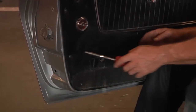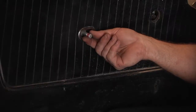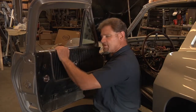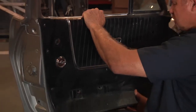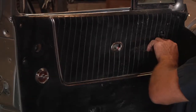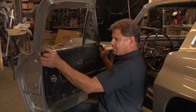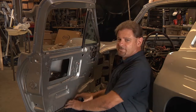You have about 13 Phillips screws holding the door panel on, two Phillips screws holding the armrest, and a twist knob for your door pull — unscrew that. Once you have it all removed, there's a lip across the top. Gently put your knee underneath there and give it a little wiggle to get it loose. Watch the area where the door opening is, and also clear where your window crank is. Once you get that clear, pop it up. Grab it on the front side and back side, then we'll go ahead and take the rest of it apart.